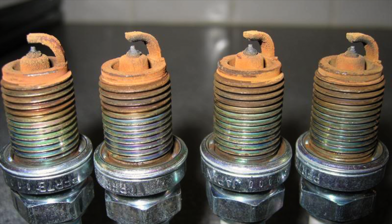The first positive is the higher octane. Usually if I want to run my highest boost map, I put in a fuel additive like Torco or VP Octanium, which gives a healthy boost in octane rating when using pump gas. Per calculation, that would put me around 98 octane — relatively close to 100 octane race fuel. But the downfall of using those additives is that a lot of them have MMT in them, which coats your spark plugs and O2 sensors in this orange powdery residue. It can cause damage to your spark plugs and possibly your O2 sensors as well.